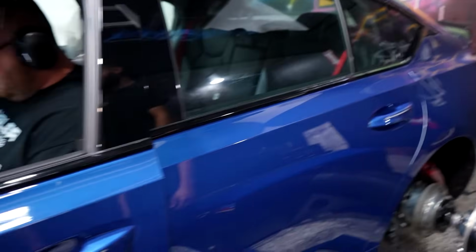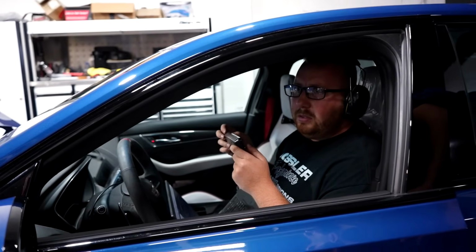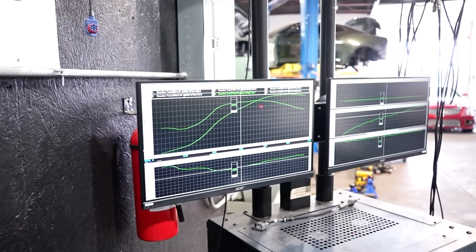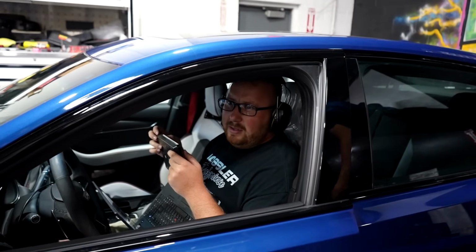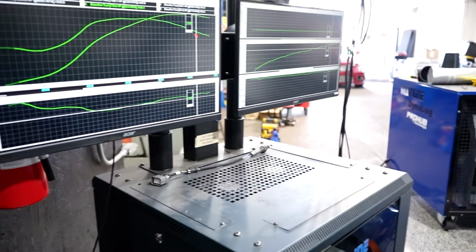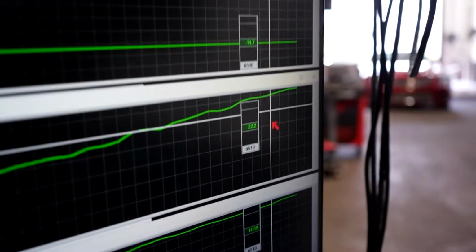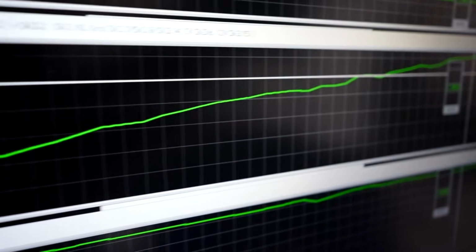Good power, dude. What did it make before? Let me see if I can pull the video. It was on 93 when I had the numbers. Yeah, the last time we did it, it was on 93. Okay, no, that's definitely more than what it made. A little lean right there for some reason. Is it meth? Let me touch that up a little bit. What's the boost say on that? 22.2 and 21.